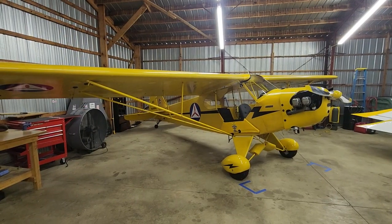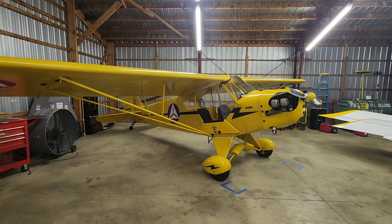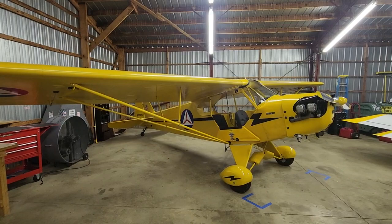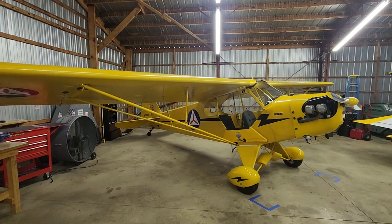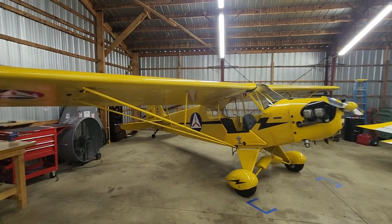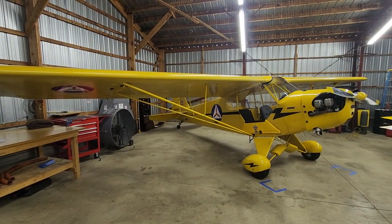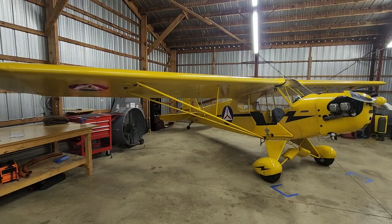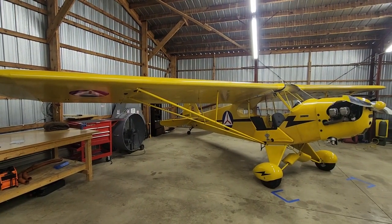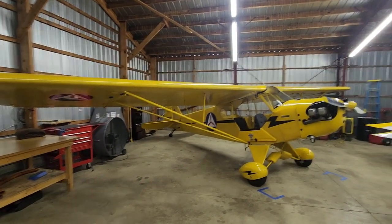This particular airplane was completely rebuilt in 1984. At that point it was swapped out for a Continental C85, 85-horsepower motor, as well as some other modifications. It was basically like that for a number of years, and then in 2023 underwent a partial restoration — the motor was given a top end overhaul and the interior was redone as well.